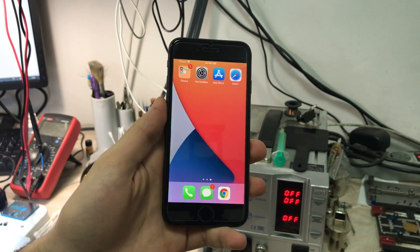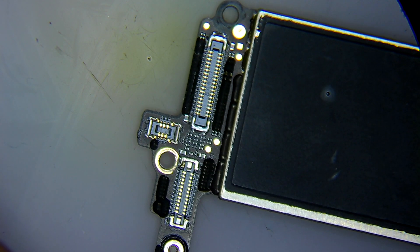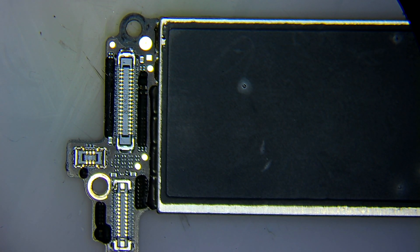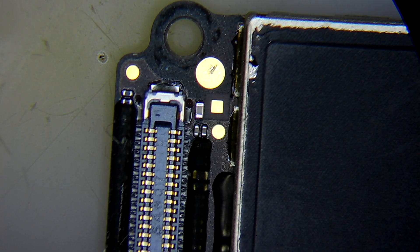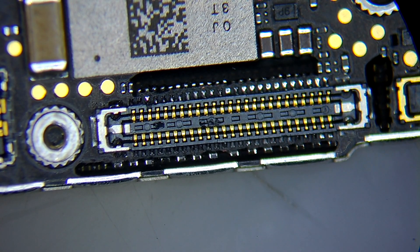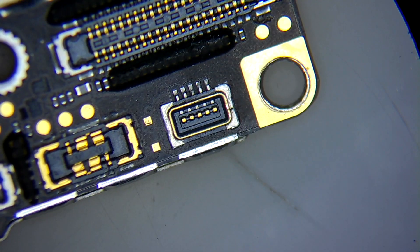Let's jump under the microscope. The basic diagnostics is to check if everything is okay with the board — whether it's water damaged or the phone was dropped. After that, we're going to go to a typical common Qualcomm area: the PMU baseband, which has a very common problem with the modem firmware. We're going to remove it and check every pad for resistance using the multimeter, then solder a new one.